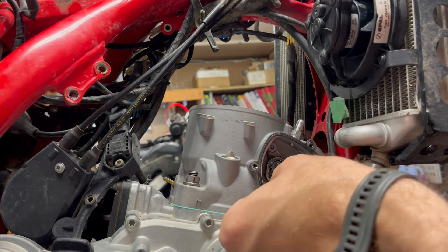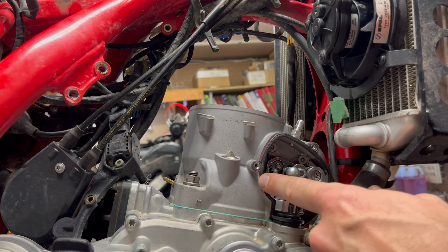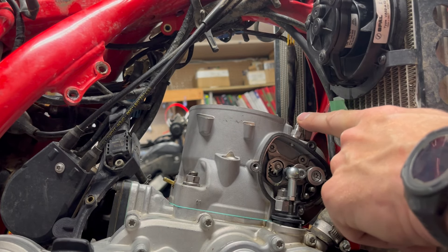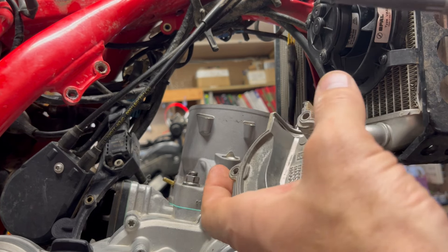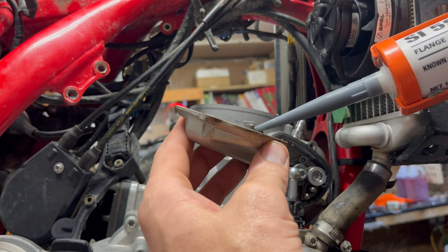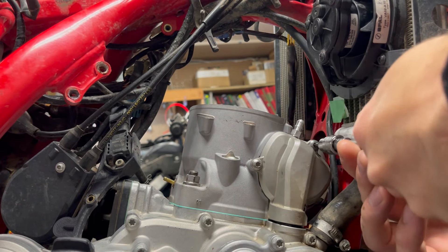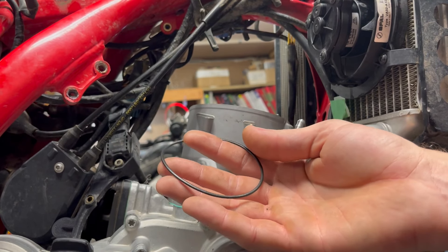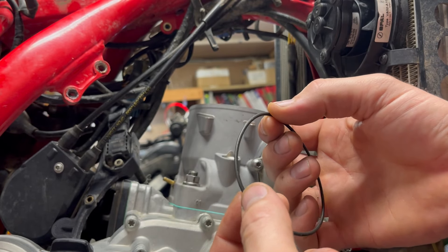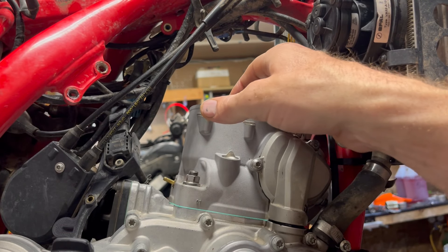This gasket cannot be trusted to hold oil — transmission oil will come out of here. This is the transmission vent, often mistaken for a power valve vent. I'm going to put some 5910 in this groove and all the way around here because they leak. I'm actually pretty comfortable reusing this O-ring, but I've got this bike pretty hot during testing — hottest I've seen is 263. This O-ring is a little bit flattened and I have lots of O-rings, so no sense reusing it.